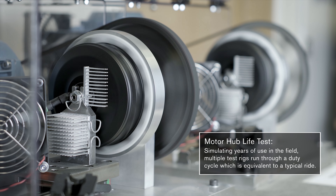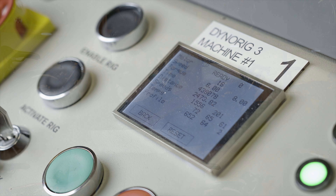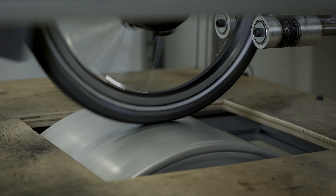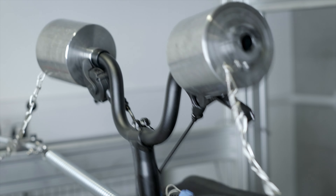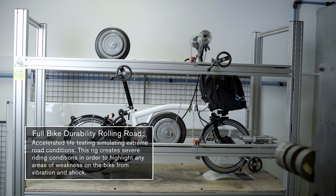This provides some distinct advantages. A mid-drive motor would impede the fold of the bike, while a rear-drive motor would prevent the use of an internally geared hub. The complication of just slapping a 250-watt motor on the front wheel, though, is that it puts a lot of extra torque on the front fork, which can be structurally problematic. Brompton has addressed this issue, however, by strengthening the front fork so that it can handle the extra pulling force that the motor puts on it.